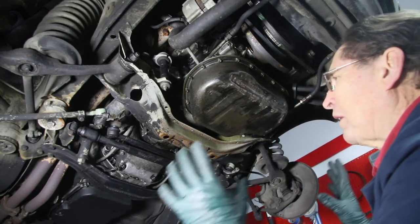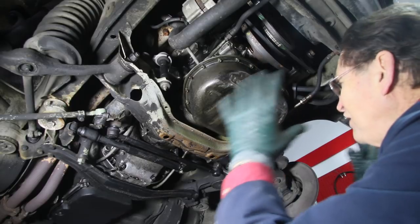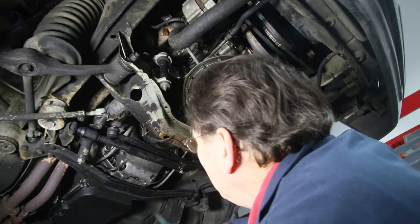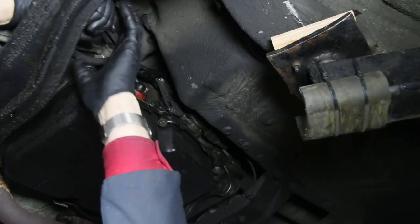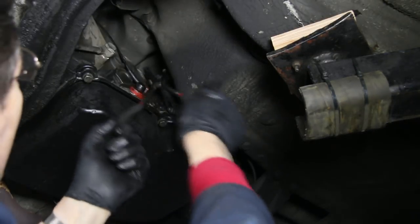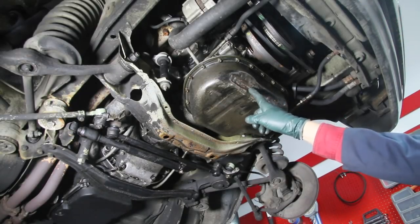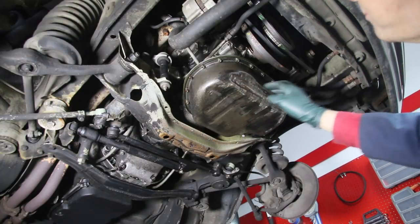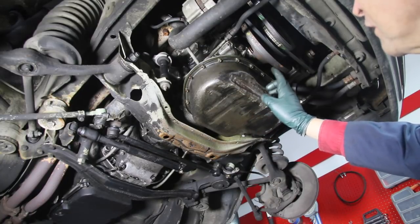You can see I've got Fritz up on the lift and we're ready to do a major service. I'm going to focus on the engine oil, transmission fluid, and the brake system, including a complete brake fluid flush. I spent some time earlier this week checking out the transmission and sure enough, the shift bushing was totally shot. Look at me straining to get that front shift bushing on - that was tough. If I hadn't had that special tool, I would have never been able to install that front shift bushing. It's really nice now - when you shift it, there's no rattling or slop. But when I was looking at the car, I saw this right away - this does cause me a little concern. I don't know if it's gone in far enough to damage the oil pickup, but that's a pretty bad dent. Somebody hit this pretty hard, probably on some sort of parking curb. I went ahead and ordered a new pan and a new pan gasket. When we drain the oil, we're going to start on this first.